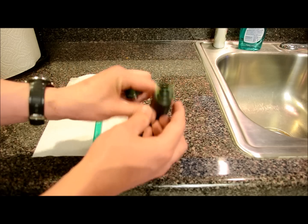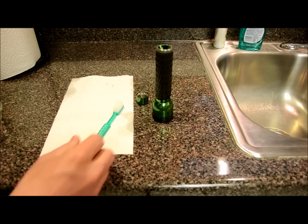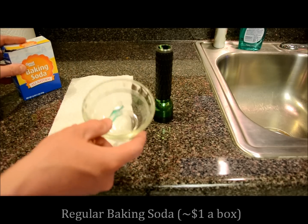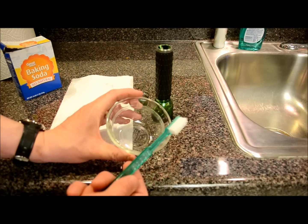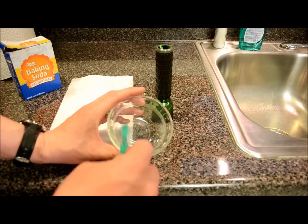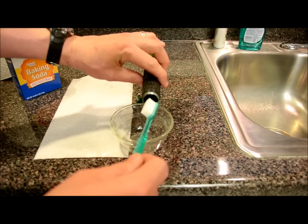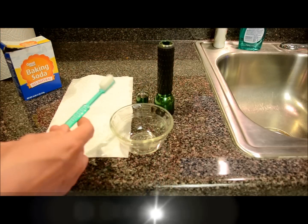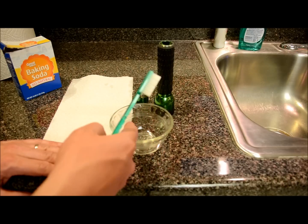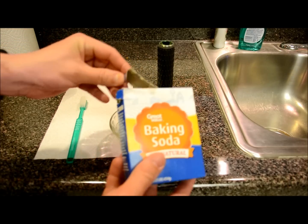So I'm going to show you how to remove this safely today. First thing you're going to need is some sort of tool to put the miracle of baking soda on there. We're going to take some baking soda, put it in a little container, a little bit of water. I'm going to use this toothbrush before we throw it out — it's one of our cleaning toothbrushes. We'll put the baking soda on that and rub it in there. It'll fit inside this battery case. Sometimes you might have to resort to something smaller. I use a q-tip a lot for those spring contacts down inside of a toy — q-tip works really good for that.